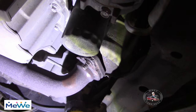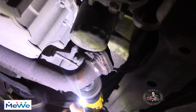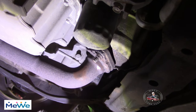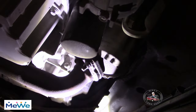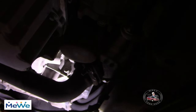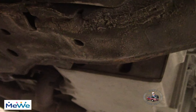Let's see if we can get these off of here. That one's really hurting. We should be able to get them off with those extractors — they don't look that bad. They're not nuts anymore, they're more round. We got to do the other one back here. Two more back there and then we'll start putting on the new Y-pipe.